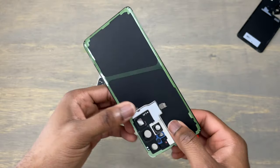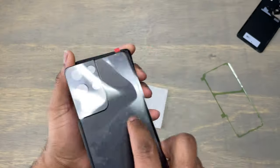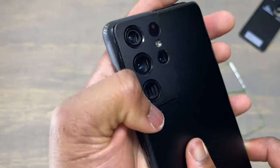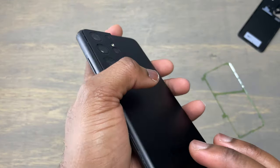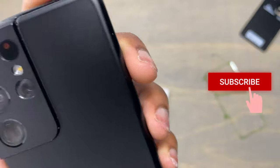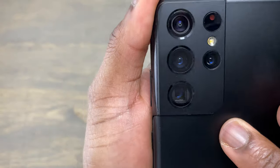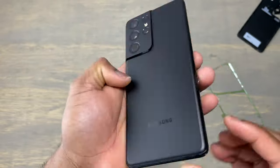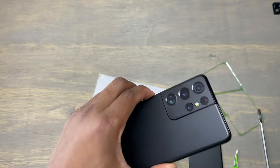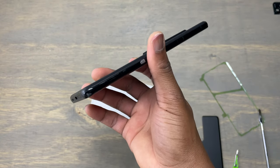After installing all those components, we are ready to install the new back cover. Put some pressure around the back cover so that the tape sticks firmly, then install the back cover on the device. Remove the outer protective film and align the back cover with the frame. Since the frame is not flat and has sharp turns, you need to be very careful — I had to try multiple times to get the perfect alignment. Make sure you align especially the aluminum piece, as that is a weak point where water can enter. Apply the back cover firmly onto the frame.